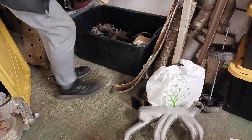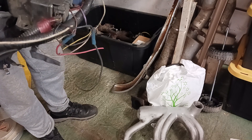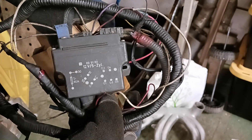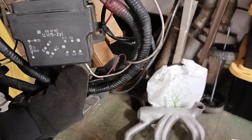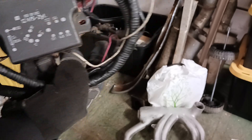We've got the glow plug controller — that's for the 5-cylinder. You can see the part number on that. It's good to use because it controls a little extra delay, keeping the glow plugs on while it's running. It actually smooths out these motors.